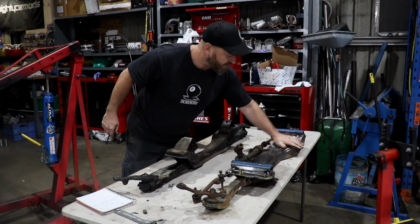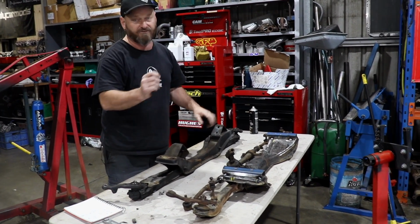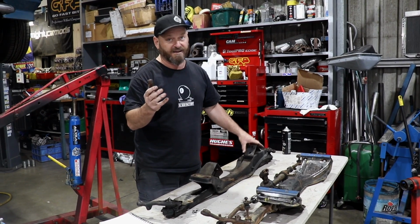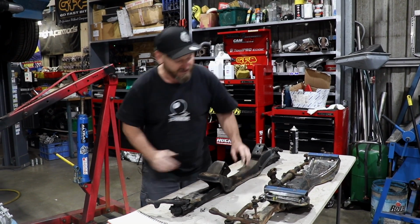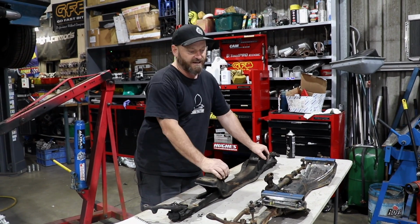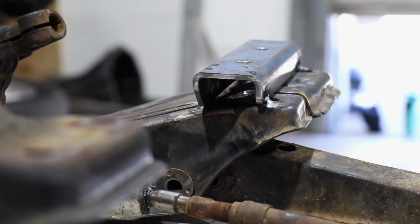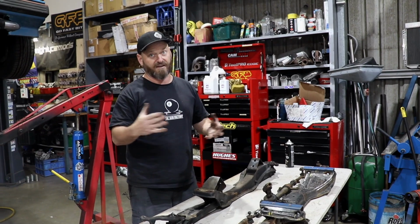I've cleaned off all these engine mounts. I used to have a big stand up here somewhere, cut them off. It was pretty straightforward. Ripped off all the mucky rack stuff, fitted it up into the car, made measurements, figured out this point here and this steering path against my measurements on the car, and then made up these spacers to go between. That's all tacked up now. It's in the car. Now we can move on to checking other alignment things.